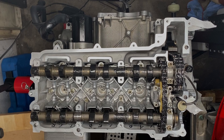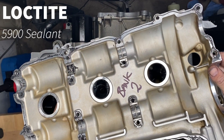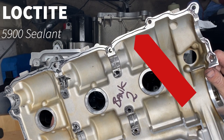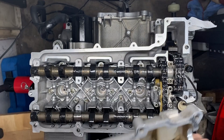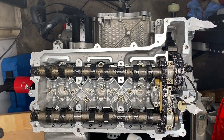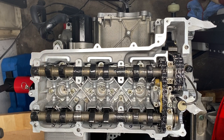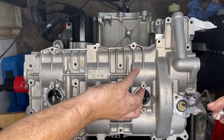That's most of the tricky bits done — now it's just time to put the cylinder head cover back on. Here are the Loctite sealant jobs I did. The one piece I got right is that piece there — you want it very thin on the outside of the middle, otherwise it risks squashing inside and blocking up some of the oil passageways. That's why I redid bank one.